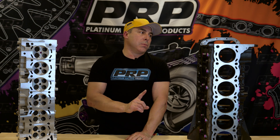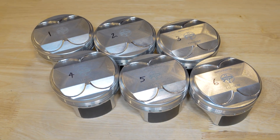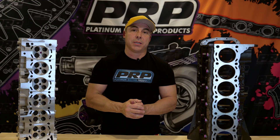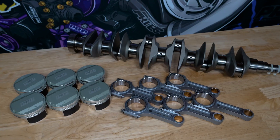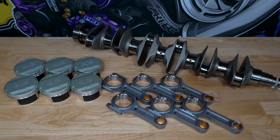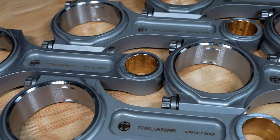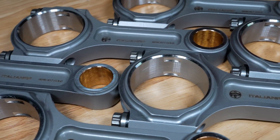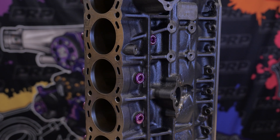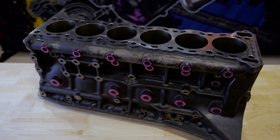This one's an 86mm bore. We're going to run a standard RB26 billet crank with some IRP pistons and rods for our testing, because we want to test our worst-case-scenario RB26 2.6-liter capacity and give it hell. We've got 90mm pistons here which have just arrived — custom made by Italian Rods and Pistons for us with a special 2.65mm longer rod. We've increased the deck by 2.65mm to allow for the longer rod.